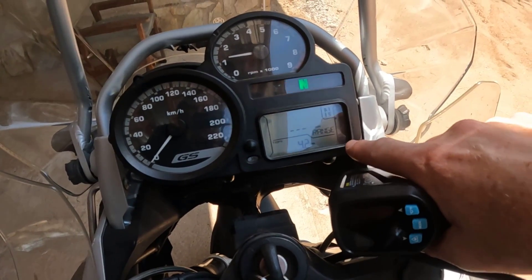You probably can't see it but it's just starting to heat up — it's at one bar, and I think if it reaches the little triangle at four or five bars that's normal. The question is why would we want to know whether there's a difference between the two cylinders. I would expect them to rise at the same rate because the same thing happens on either side — two spark plugs firing with the same timing — so if they work properly they should rise smoothly and reach the same temperature at operating temperature.